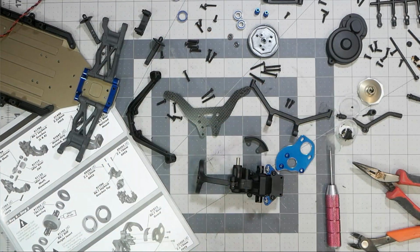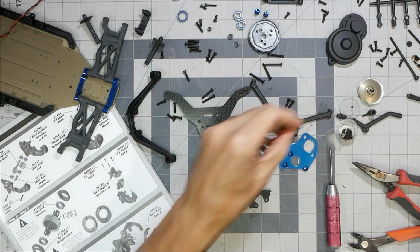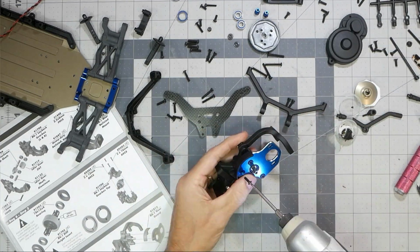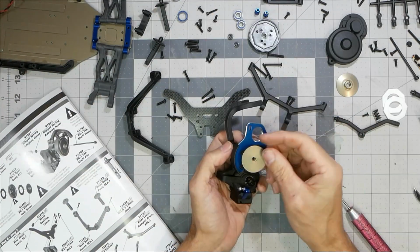This is the point where you're trying to make sure you don't get the wrong screw in, because some of these screws are very specific in length. If you put the wrong one in, a short one's not the problem, but one that's too long, you'll end up blowing out the back side of the case or doing some damage to it. So you really want to take your time and measure those out.